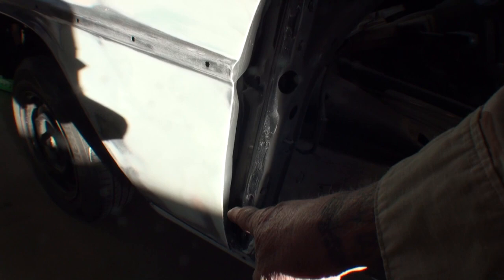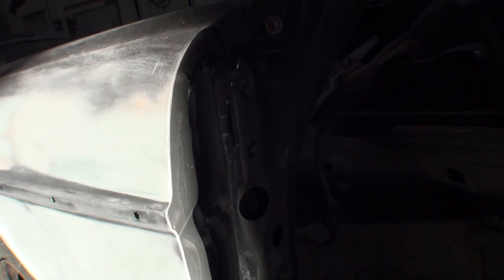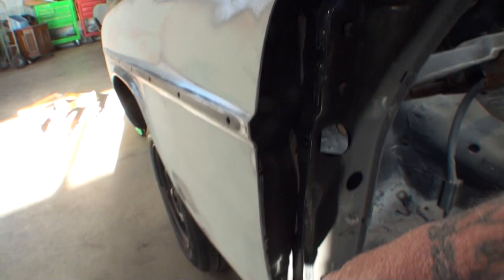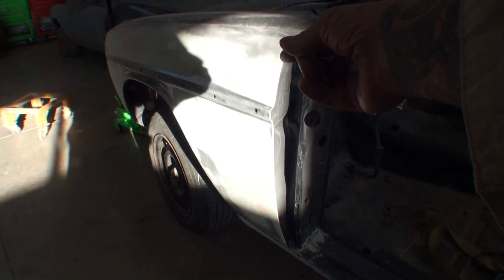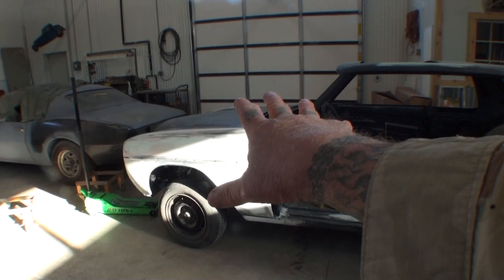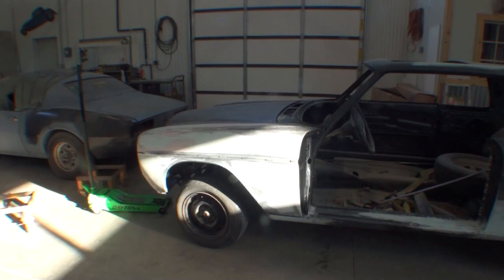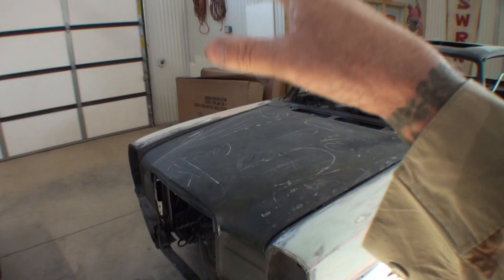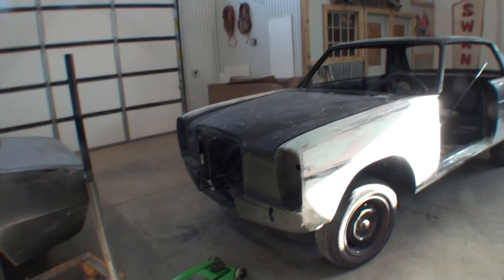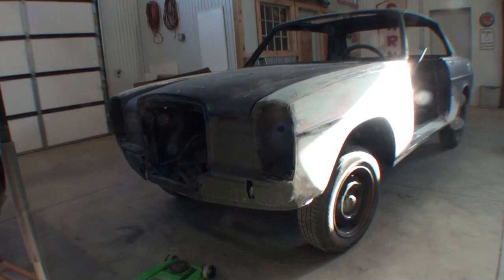Now these fenders, if you look inside, you can see how they're glued to the body, and they also have this panel that is pinch welded all the way around. When I say pinch welded, it's rolled just like a door. It's got a pinched roll that holds that together. So this fender only goes on one way. All right, there's basically no adjustments. And if there is any adjustments, very, very slight adjustment. So when you put this thing together, that's it. Now the hood does have some adjustment. We haven't adjusted the hood properly yet because we got to take it off. But as far as the fenders go, there's really no adjustment at all. If you look at the fenders, it gives it the illusion of a one-piece molded body. And then, of course, they bolt to the core support.